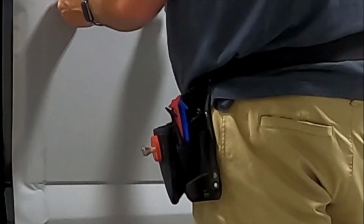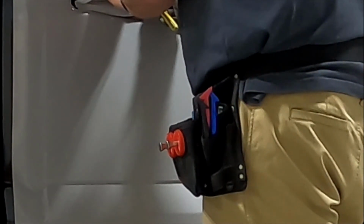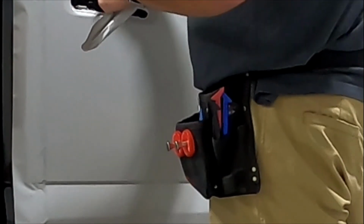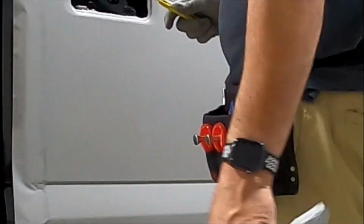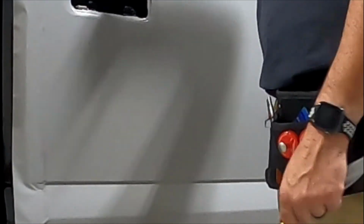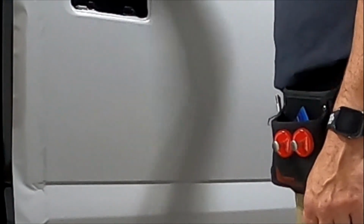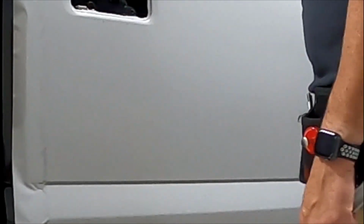And I'm sure you guys have seen those videos by now, where people will cut vinyl on their arm or on a balloon to test themselves as to where their knife pressure and knife skills are as far as it comes to doing vinyl. The way I learned, the way I had to do it for my certification, is cut yourself a 12 by 12 piece of vinyl, slap it on the glass, put another layer on top of it, and then test yourself drawing S's with your knife blade, but only cut the top layer, not the bottom. Once you can do that, you can get a feel of what the pressure needs to be.